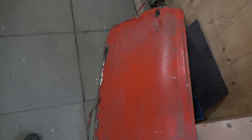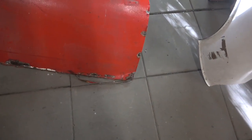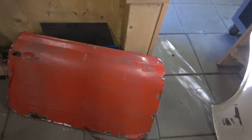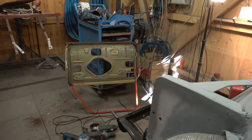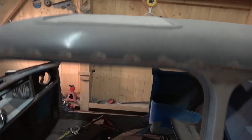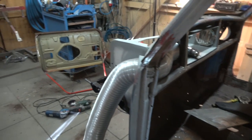It just isn't worth repairing a panel like that - just cutting off the bottom and doing it never looks right. In certain lights you can see repairs terribly so you're better off with a new skin if you can afford it. To be honest with the working hours, filler, and welding involved, it's just as quick to do the whole skin. They do rot where the contact points are anyway. As usual, stay safe, keep your faith, enjoy your hobby - we'll bring you back when we've got some more work done on this. Be good to each other, bye for now.